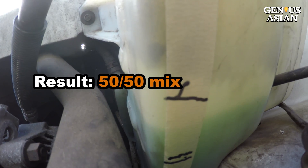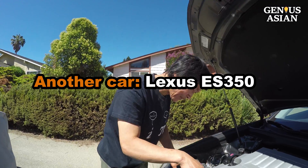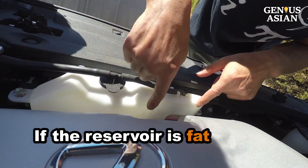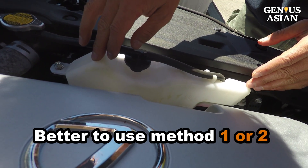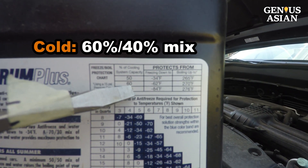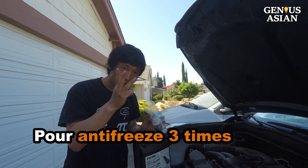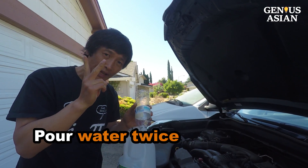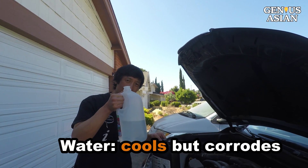The reservoir is so wide it's very unlikely to be very accurate, so it's better to use the first two methods. When the temperature is really cold, you need a 60/40 mix. You can pour the antifreeze to the same mark three times and then pour the water to the mark twice — that will make a 60/40 mix.